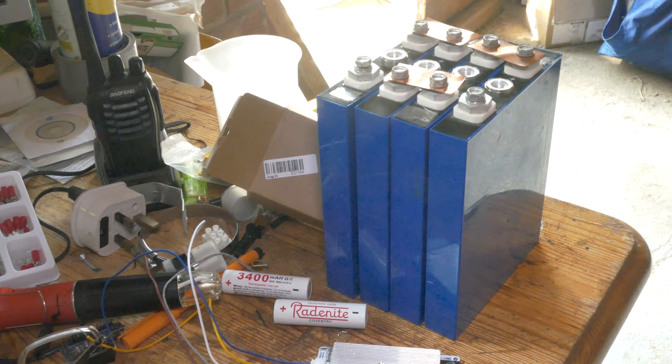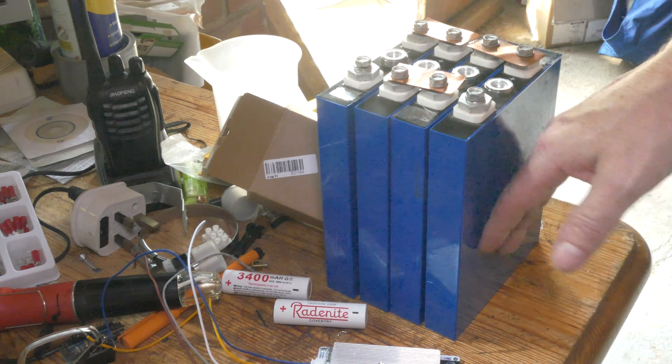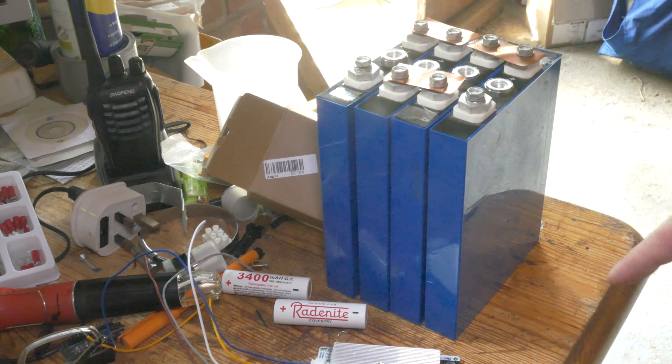One of the crucial parts of a battery inside a car is to be able to crank the engine. The cold-cranking amps in my own car — the battery is rated at 800. The cold-cranking amps of these cells tend to be nowhere near that. So the first step is to find out just what the scale of the challenge is by cold-cranking my motor car and seeing what the maximum peak current draw is.